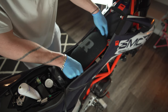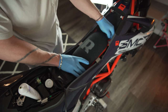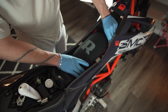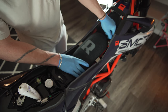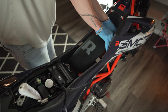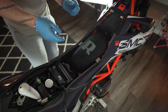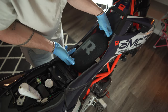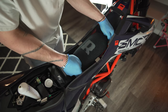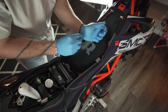That should lock in place. All right, there we go - you know it's in place when you can't lift it from the other side. I'm going to go ahead and put these screws in - there's one and two. That is in place. I'm going to double check - pull up on this side, nothing, can't get it up, and this side is good. We've got the rim grease, everything's sealed and ready to go. Now all we have to do is put the seat back on.